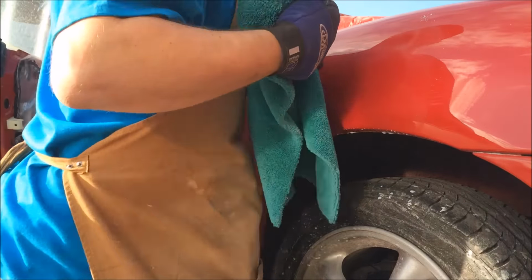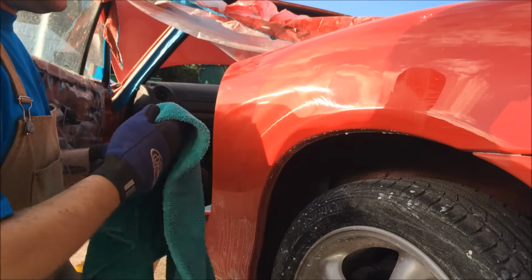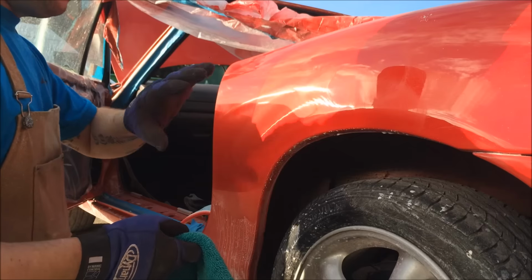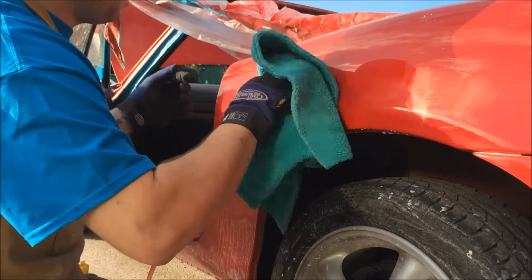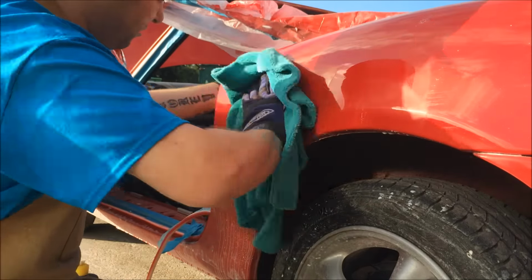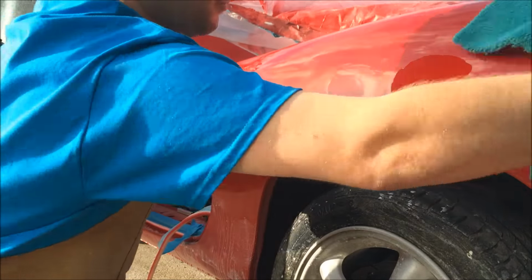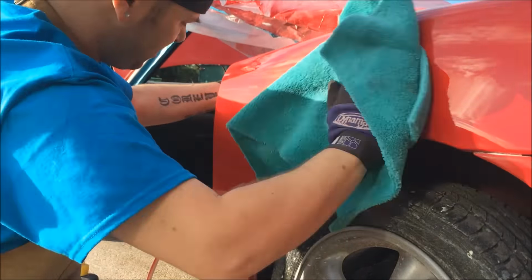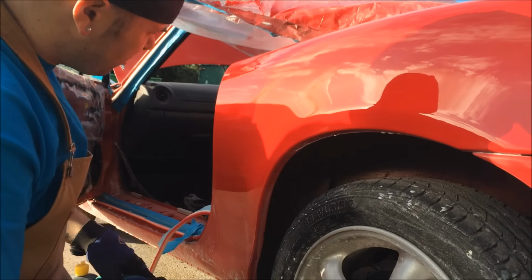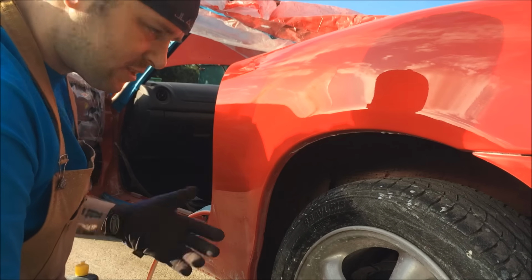Microfiber, these are from Auto Perfection and they're brilliant. We got these and we use the purple towels, and after this we put their ultimate wax over just to finish off. All right, so you wipe off now, like so. And then you check in the light, make sure all your swirls are gone. Make sure you've got no scratches. And that's it. It's as simple as that.